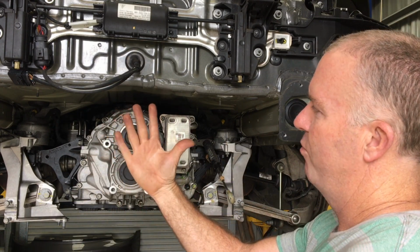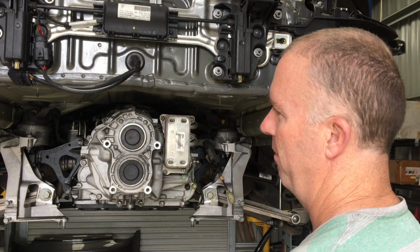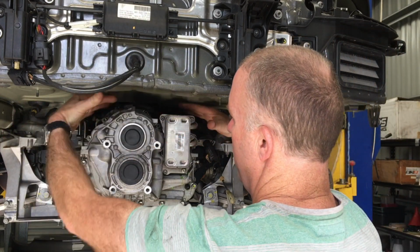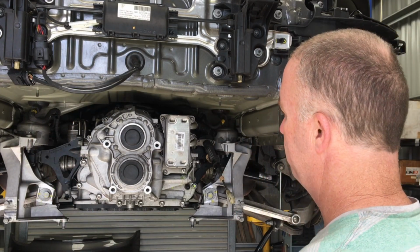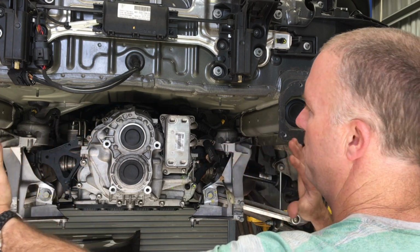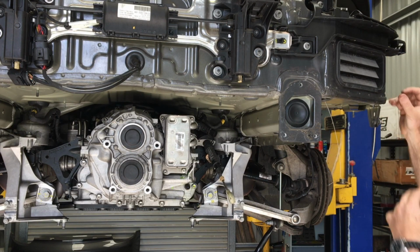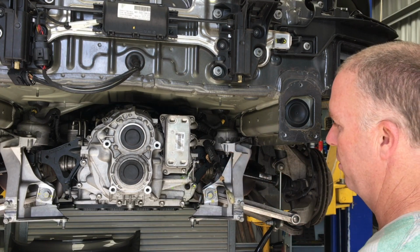On the inside of where the bumper was, there's a small frame which is a support for the bumper. That has 3 screws that can easily be removed. There's a piece of heat insulation that sits along here, as well as the big one underneath there. They're pretty easy to remove. They just sit on these studs here with some nuts. Once it comes off, because with the exhaust, it's much easier to remove that with the bits on the side here removed. I haven't made a video of that, but they just have 4 nuts. There's 2 there, 1 there, and 1 on the inside, and they just pull straight off. So you do that on both sides, and the exhaust just comes out much more easily afterwards.